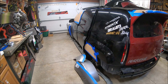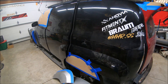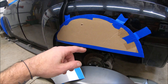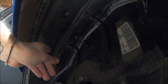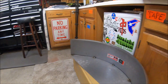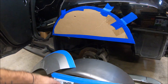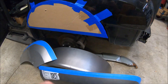I'm planning on wide bodying this thing. As that process is going, you can see I've got the fronts going already. The rears are going to be quite the process — this is going to be testing a lot of my abilities. Basically, you can see I've done a cardboard template; this shape is literally getting cut out of the side of the car. From underneath, where the stock body line and pinch weld stop, I'm going to be cutting that and taking this whole section out, then installing a trailer fender to replace it, bringing it out two inches.